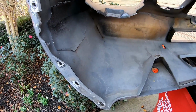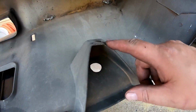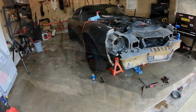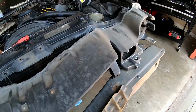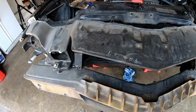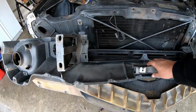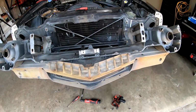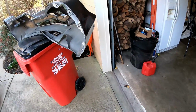All right, in addition to all these bolt holes, you've got 2 here, 1 there, and then 1 way over here. But I think the biggest lesson learned is that this lip fit around this piece here. This piece was held on by 4 bolts, and I'm sure it was more than that. As I took it apart, some came off, but the 4 bolts that remained I didn't take out, because I thought, hey, this isn't part of the skin that I'm taking off. You flip this over and you see there's 2 there and 2 there. If I had taken those 4 bolts off, the front nose cone would have come off a lot easier, because of this lip.